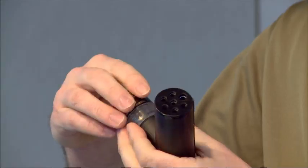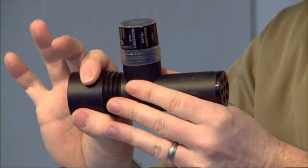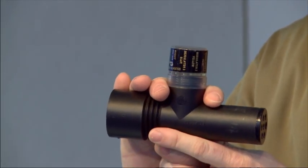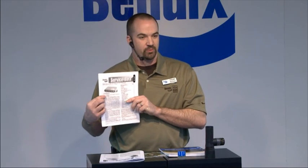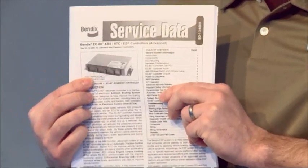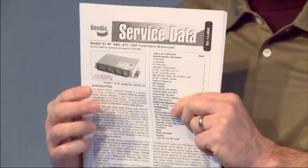There is also a seven-pin adapter so you can power up your trailer — plug it in quick and simple. You have to have power on the trailer in order to pull the ABS faults off of it. Once you've gotten through the faults, what do you do when you see a fault? As an owner-operator, if you don't have one of these tools, use blink code diagnostics. Bendix releases service data sheets — that's our terminology for the repair manual for your product. Anything Bendix manufactures has a service data sheet.